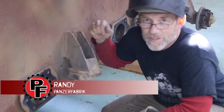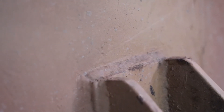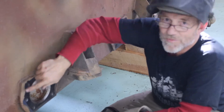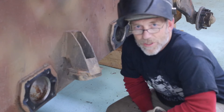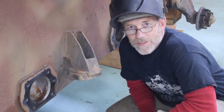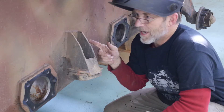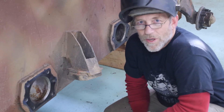One of the big challenges we've got on retrofitting all of these mounts is the big welds that are on a lot of these pieces right here. This guy is welded on — his flange right here is welded, you can see these big welds. So what I'm going to attempt to do without hopefully screwing up the tub is go ahead with a plasma cutter, go in and melt those welds out so that we can get it down close enough, maybe touch it with a grinder, take a chisel and pop these things off without destroying anything. So this is how to remove a weld 101.